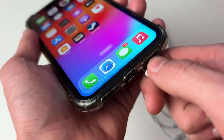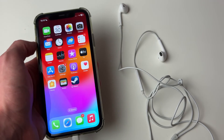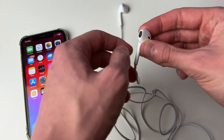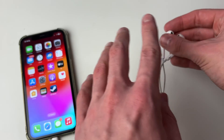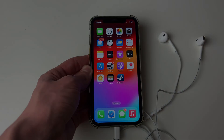After clearing out the port, plug your headphones back in and hopefully that'll fix your problem. If you're finding the sound is very muffled, check and clean the speaker parts on the earbuds themselves, as that could be the issue. Those methods should fix your headphones not working. If you found this useful, please consider subscribing and liking the video.